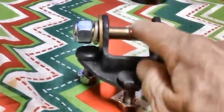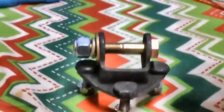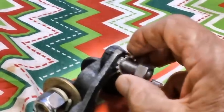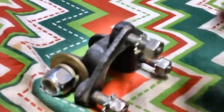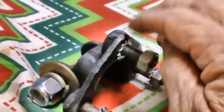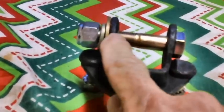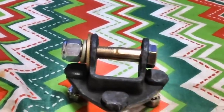That's how we're going to hook it up to the top of the control arm. The whole thing will bolt to the bottom of the shock, and then the entire shock will slide down through the center of the coil spring with this attached. These three bolts will go through the holes in the top of the control arm, and we'll tighten up the nuts on the bottom. They originally had star washers on there — replace those. Don't use old nasty lock washers and star washers. It's a safety issue. Brand new everything. I just need to straighten up this bent ear here if I can.